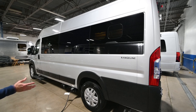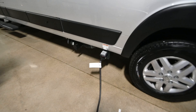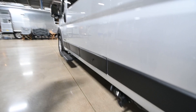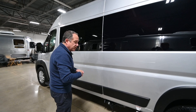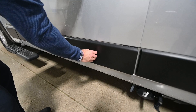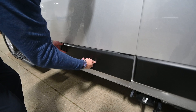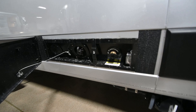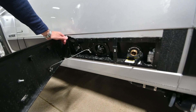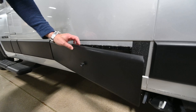As we walk up to this side, we're going to see our power cord — we use a 30-amp smart plug power cord. We're also going to see our waste tank outlet here, which are black and gray tanks. We have all three: fresh water, gray water, and a black water tank on board. In the back we have a little sewer hose pipe to hold our sewer hose so we keep the stinky-slinky away from everything else. As far as hookups, we've hidden it with the applique here. We can simply unscrew the little locking nut here and have access to our water hookups for the waste tank flush, our fresh water hookup from the city, and a hookup for our outside shower. Everything hides nicely right underneath the hidden panel here.